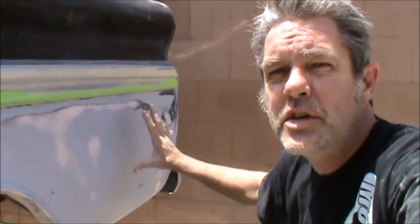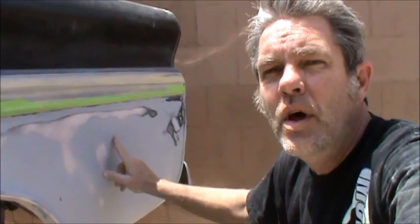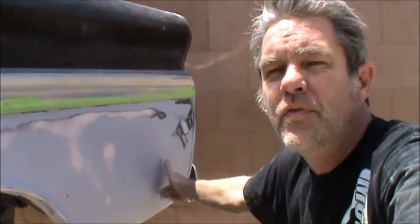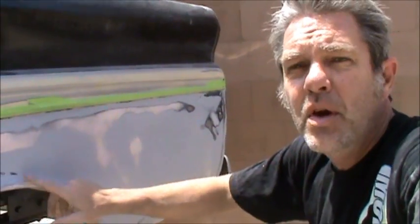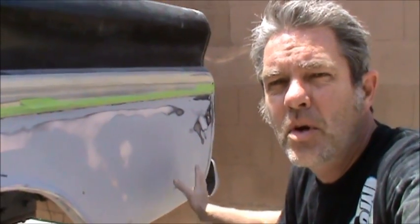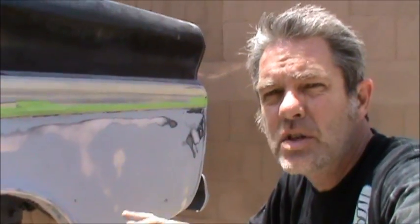And you can just hit this with a sealer coat too if you just want to do it a little bit quicker, but preferably the final coat will have very little or none of this filler and shiners shining through. So we'll get a little wax and grease remover on there. On any place we've got metal, we'll hit our acid etch primer, and then the rest of it we'll do our filler primer. And again, this filler primer out of rattle cans generally isn't that good. You've got to shoot it on real thin.